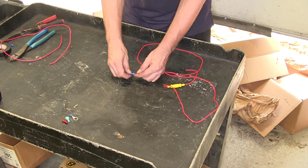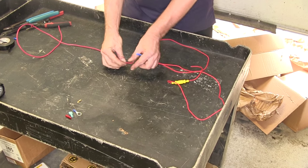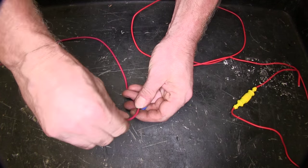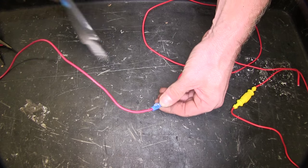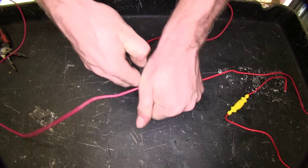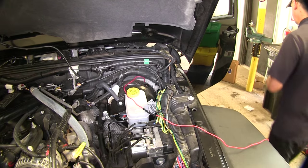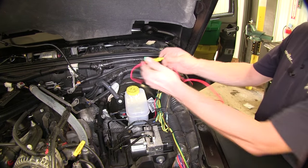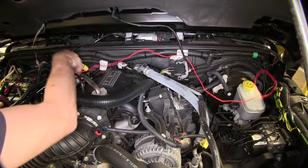We'll use one of the butt connectors that come with the kit and add it on, using a piece of regular primary wire — it doesn't even have to be very big: 16, 14, or 18 gauge will work. Not much current going through; we really just need a signal. Since this will be somewhat outside, we'll go ahead and protect this with some electrical tape as well. We'll run it through the opening and pull some of the slack through, then run this end with our fuse holder. This is an old-style glass fuse holder, and we'll route our wire harness across to our battery.